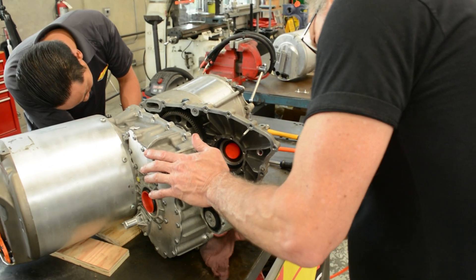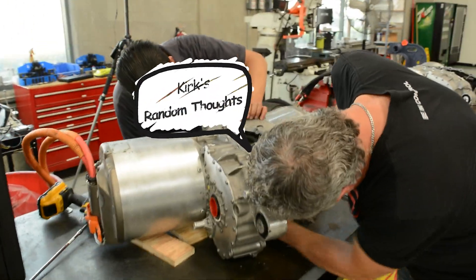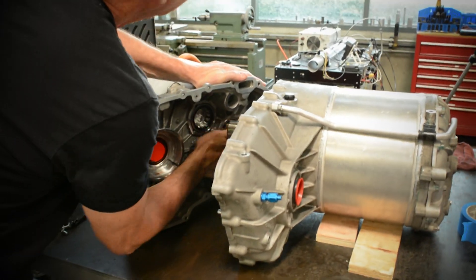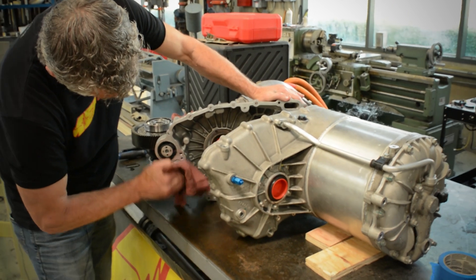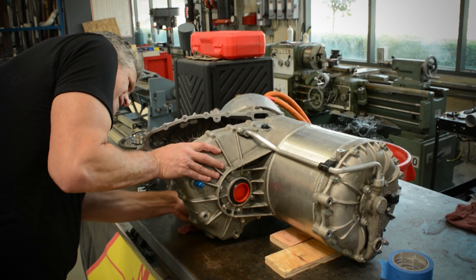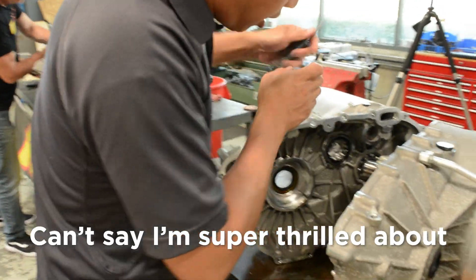This side must be the sling side and they're trying to do some extra protection on the case. You'll see there's an O-ring, Sam, that runs the length of the case, so just be cognizant of that as you're cleaning. All the Euro stuff I did, we never used silicone on the cases. We used a compound designed for cases that hardened under compression on the machine surfaces, so you never had to worry about silicone. Your oil pan was actually the transmission case, and the gasket over time between heat and pressure would compress — so all the bolts would loosen up and fall out. You'd have a car come in with a terrible oil leak and you could reach under there and feel around — there were no bolts on one side.